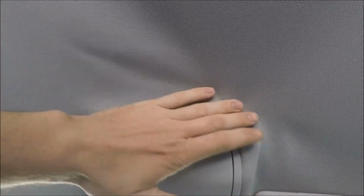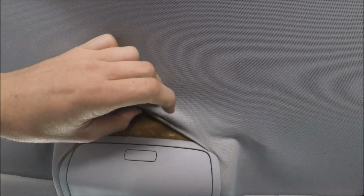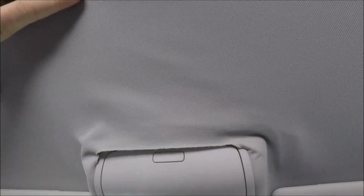It's quite an easy method, rather than trying to sand back someone's glue that they've added or cement paste, and doing that, you can actually damage the headliner board. So it's best to stay away from adding any glue to hold these fabric roof linings up once they fall. So yeah, we're going to get stuck into that now.